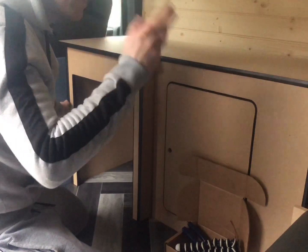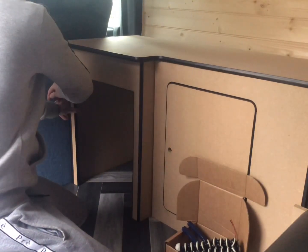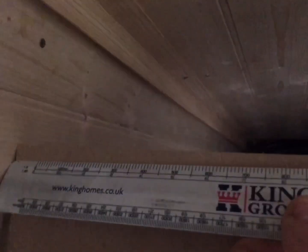I'll cut my scribed marks up and start from the back, work my way forward. I can explain it a wee bit easier on this panel. The other panel will go there near the back doors, this one comes along and meets up with this one. As you can see I've got it pushed against it — obviously that's as far as it'll go in its pre-cut state. What you do is take a note of this gap, whatever measurement you've got, bring it up to the top, mark it, and continually mark it all the way down and you'll have yourself a curve. Then match your dots up and cut it — once you do that it should leave you with something like that.